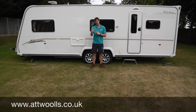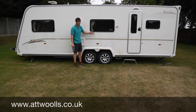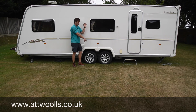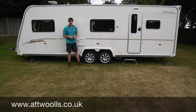One thing always to consider is when you're looking at putting something like a four metre awning on, be aware of where your windows and door are. You don't ideally want it to cross a window if you can help it. The reason is the windows are a little bit proud of the actual caravan side, so when you put the back of the awning against it and pull it tight, you're naturally going to create a bit more of an area for draught — it's going to bow out a little and you'll probably have draught gaps going down the side.